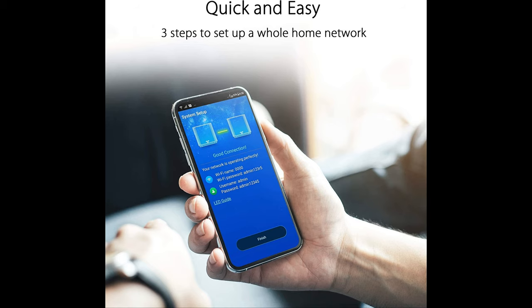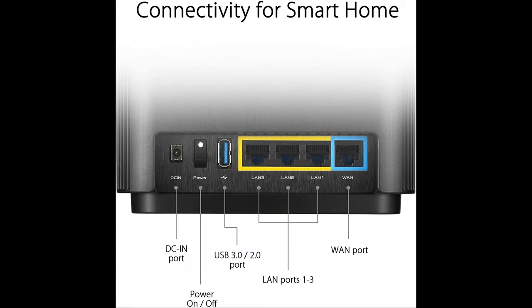Six Wi-Fi antennas are hidden inside the case, some at a 45-degree angle which improves signal reception in multi-story buildings. A set of two modules is designed for an area of up to 500 square meters. The system can also expand an existing Wi-Fi network if an ASUS router with AiMesh technology is already running in the house, and ZenWiFi can be supplemented with mesh points from the ASUS Lyra line — for example Lyra Mini — which offer good performance in the 2.4 GHz band.